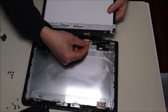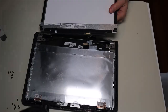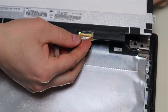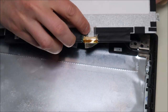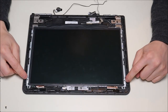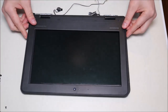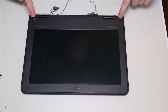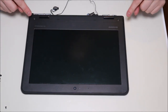To put the LCD cable back in, hold the port steady, take the LCD cable, set it flush next to it, and slide the two together. Then take the metal bar, slide it down over, and push it down to lock it in place. For added protection, make sure that sticker is back down where it should be. Flip your LCD over, put it back in place, replace the four screws, bring the bezel back over and snap it down. Put the two screws back in and replace those black stickers if you saved them.